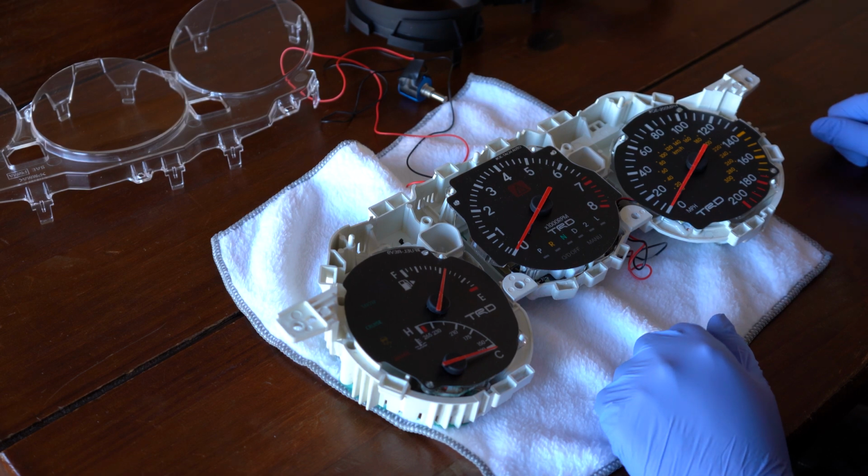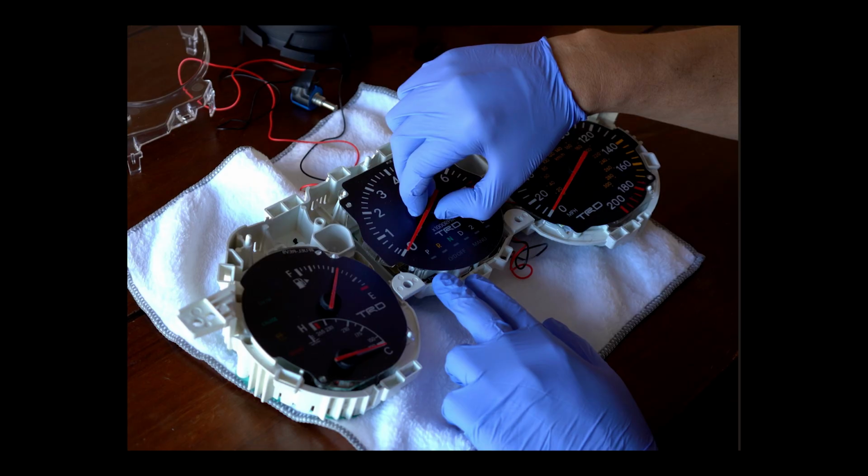And now we're going to be removing this needle. The needles on the gauge cluster and on the tachometer are calibrated. And essentially what happens is if you remove them or you modify them, an individual could bench test the gauge cluster and put an artificial signal for an RPM specification. And at that point in time, they could adjust the needles so they have a calibrated setup.